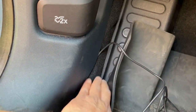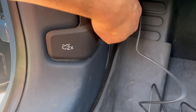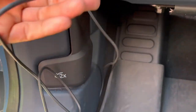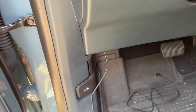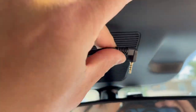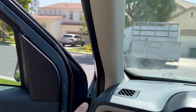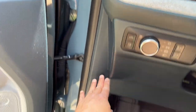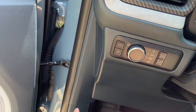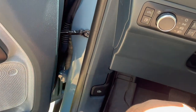You can see I have the wires just tucked underneath all the way up, and now it's up here. I'm trying to do this with one hand, but I can tuck it in and route it up through there underneath. Now that I've got the wire routed all the way up, I'm going to route the line from the video camera up and around and down so I can put the excess line right here. I don't want the excess line at the end where there's no room — the excess line will be in this area, underneath the plastic.